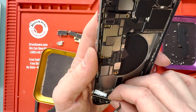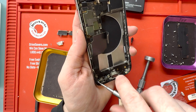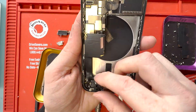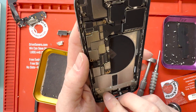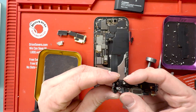Finally, we can start taking out the charge port, but then I realized there's a standoff right here on the bottom left that kind of hides underneath the flex cable, so make sure to move it and get that unscrewed. There's also a PH000 screw down there that's kind of hidden — just want to point that out. We got it removed.